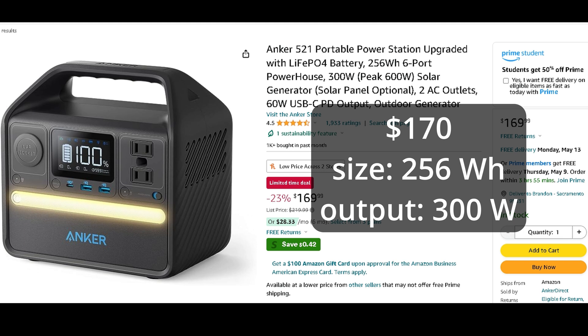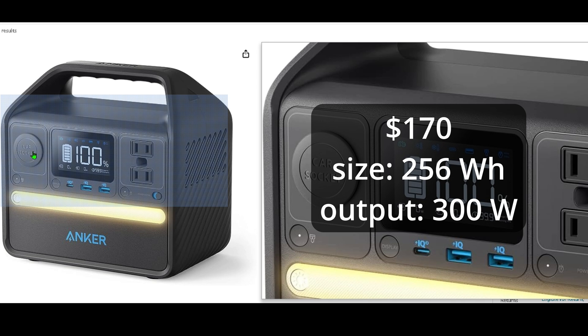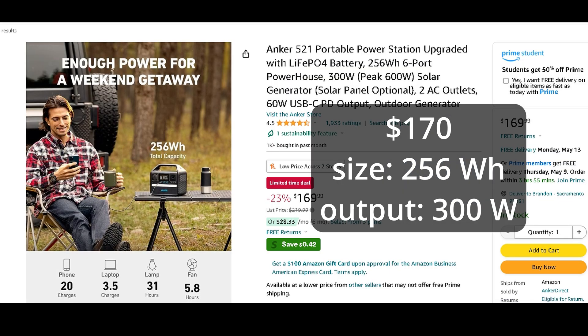Most people want a refrigerator. Most refrigerators take 40 to 60 watts for the first few minutes as they power up and cool the inside, and then idling they'll take about 4 to 8 watts, so you don't really need much wattage for that — just knock off about 10 watts from your 300 watts. Now, underglow — everyone loves underglow — and that's going to draw about 110 watts.